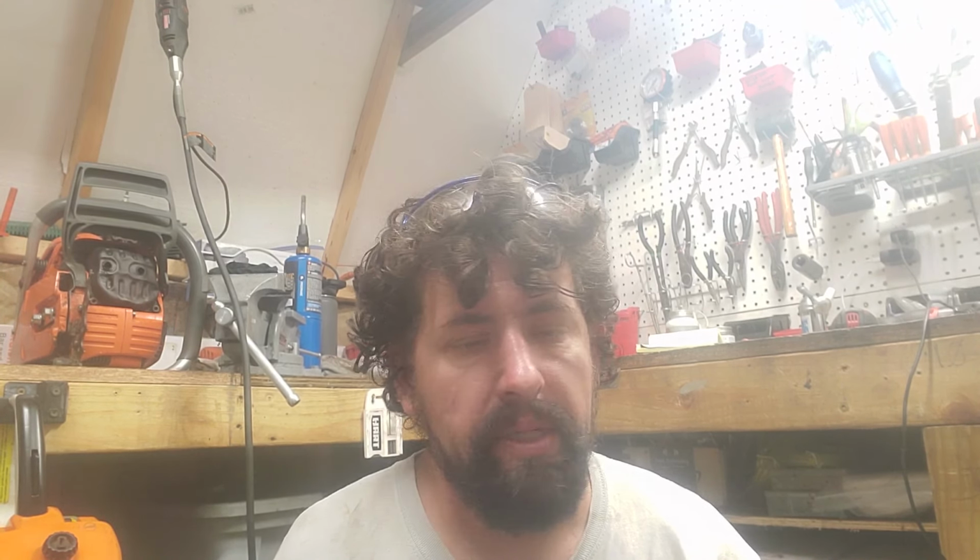That was another thing. You know, everybody says set your carb screws to 1 1/4. I really have a hard time pulling cord, and so when I go to restart a saw after certain work's been done, like a carb rebuild or a full rebuild or something, and I have reset them screws to 1 1/4, that on many saws is so rich that the saw will never even start, it just immediately floods. And then on other saws, I've had it on like Echos and various things, that 1 1/4 isn't enough, they need to come out further. Especially on weed eaters and stuff, it is a good general rule to start at 1 1/4 turns and go in or out from there.